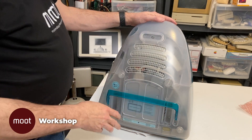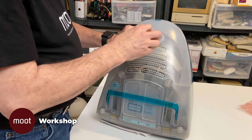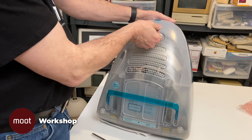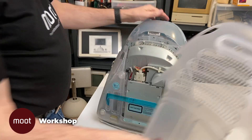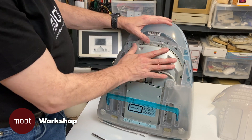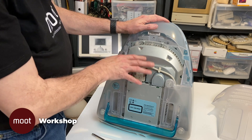The first thing we need to do to get inside is take this bottom cover off. There's a screw right here — get that screw out. Then you just grab this handle and pull on this plastic. And it popped loose, so that's the bottom cover piece. This is basically the computer; the rest is like power and video. But the computer is right inside this module here — this whole thing here. This is actually the video cable going to the video part of it.